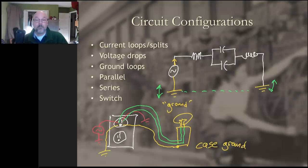Okay, especially if you've got a metal box or something like that, what happens is as an electrical cord gets yanked around and your appliance gets used, you might end up fraying part of the wire right down here. And then you wouldn't necessarily know it, but you might be hanging on to it, holding it, and you might go to plug it in, okay, and you're going to get a nasty shock, because the electricity is going to go from the hot wire, around and to you if you're holding it, okay. You could get a dangerous shock that way, all right.